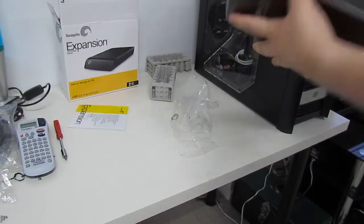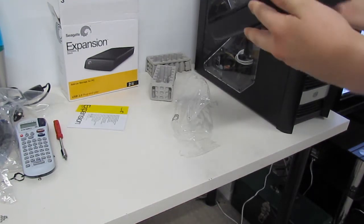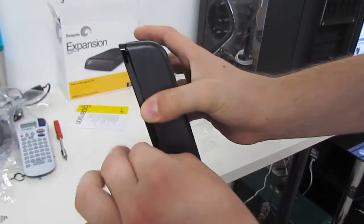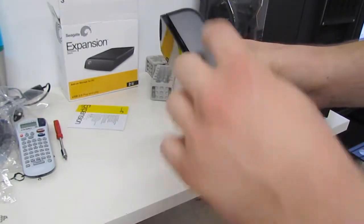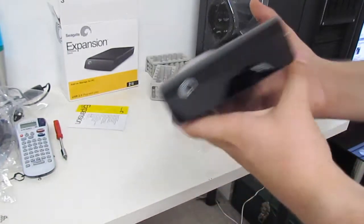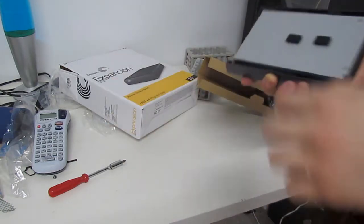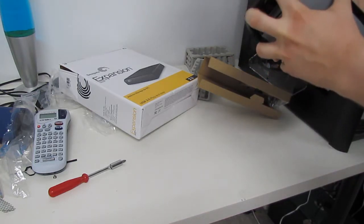Seagate hard drives aren't particularly easy to open — I've practiced on a few dead ones we picked up from Umart in their recent flood sale. Pretty much all you've got to do is start from the back and pull it straight off. There are clips inside that will just undo when you do that. Only do this if you're going to use it as an internal drive; if you want an external, just buy it, plug it in, and start putting data on it. So I had to rip this one from the front — where they have the logo — you just rip it straight off, and it undoes all the clips. You can put it straight back on.